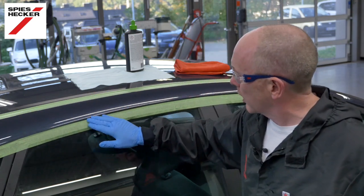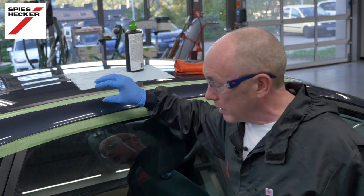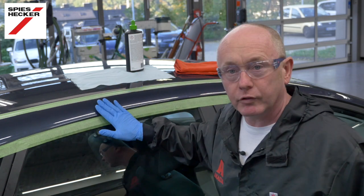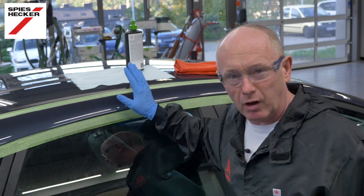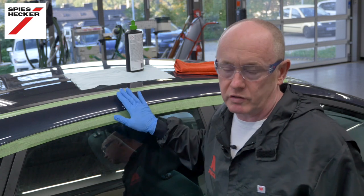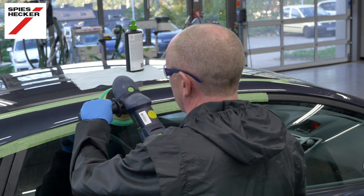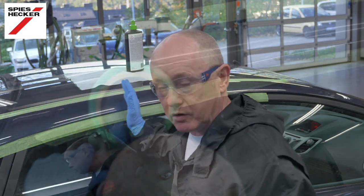Now the job has cooled down I am ready for the final polishing, and as I said in the spray booth there is actually very little that needs doing. But remember if you have a little bit of structure or a little bit of dirt or dust here, you can lightly sand this with something like P3000 Trizac and then polish, and you won't run the risk of breaking through the edge. Remember when you are polishing to go with the rotational direction of the machine, so again you reduce the risk of breaking through.